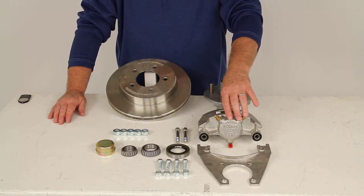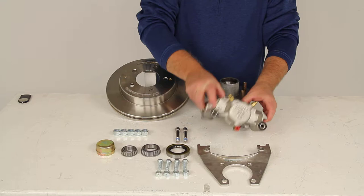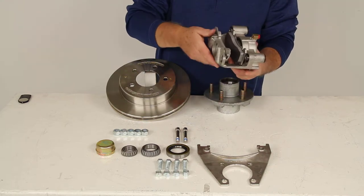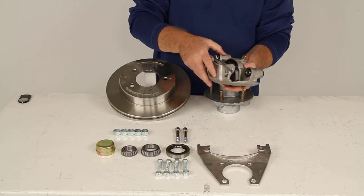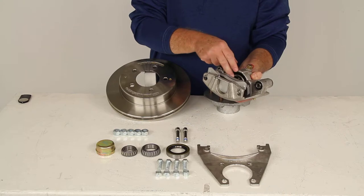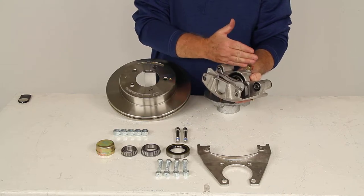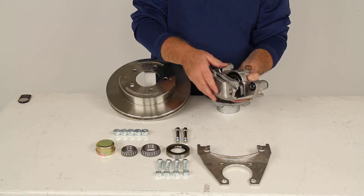The caliper itself is a stainless steel caliper which is self-adjusting, giving you nice smooth equal braking. The stainless steel construction does not flex like aluminum, and it has a low drag design. If I pop out the brake pad you can see the stainless steel piston in there. It's a low drag design which means it'll retract the piston further back, keeps the brakes off the rotor, so it gives you a cooler running brake.